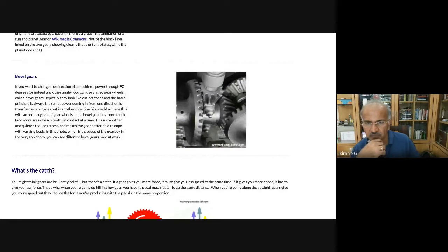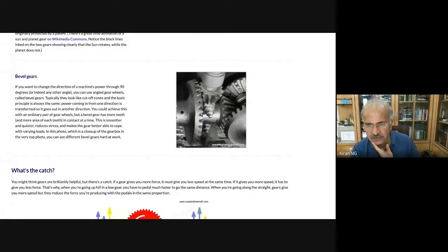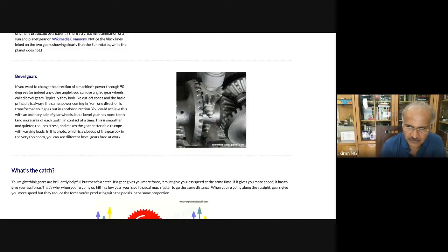Yes, sir. So this is one advantage. Another: you would have seen some trucks with multiple axles. There is a differential on each axle. So there, one is the advantage. Another is a disadvantage when it goes up a hump. When the first axle climbs the hump, then the second one will be in air. Yes, interesting mechanism, sir. I will share some animations on WhatsApp.